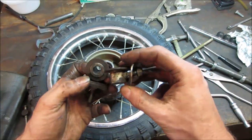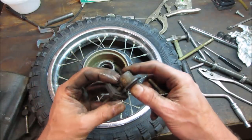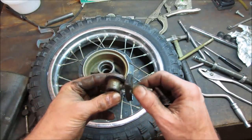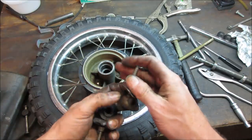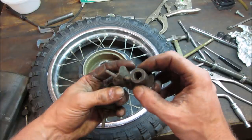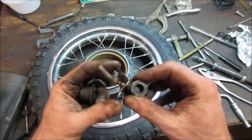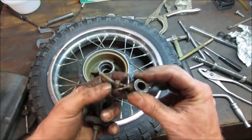But first, this goes in the frame, it looks like the square part of the frame, and this is your jack screw for holding your tension. The one that was on the chain side, which is where all the torque is, looks like either it probably broke this or is missing. And then they put a washer there, and as you see, it kind of tucked its way into place. I'm gonna do my best to straighten this out, get this apart.